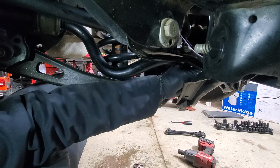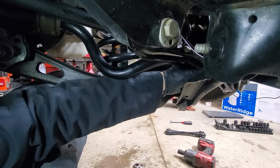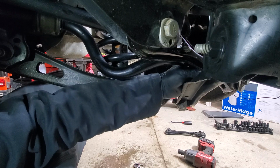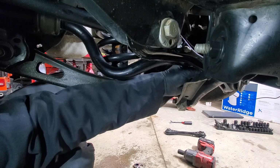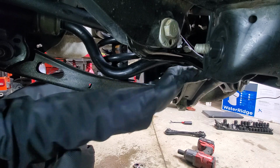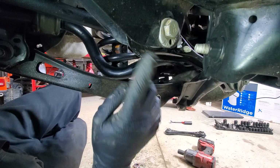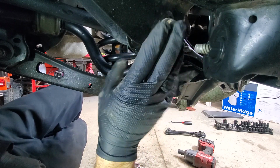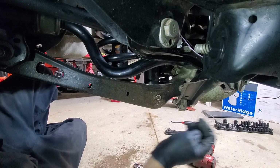as well as, when you torque those, you want the vehicle to be on the ground, so the suspension is leveled, under the weight of the vehicle. After that, you torque them. In my case, the wheel alignment will be performed, so they will get it loose, but we will torque this bolt as well at that point.